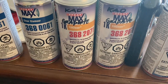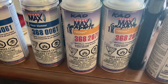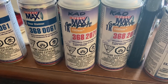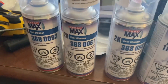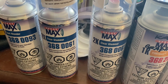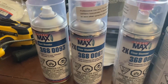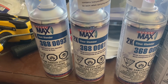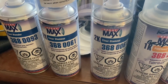I got this mixed at the local paint shop — it matches the color code. The KAD is the Nissan ColorMax graphite metallic, and they put it in the SprayMax cans. I got two of those, and then the SprayMax Glamour Clear 2K. I also have the SprayMax blender to help blend the clear coat into the areas where it ends.